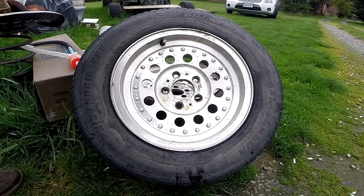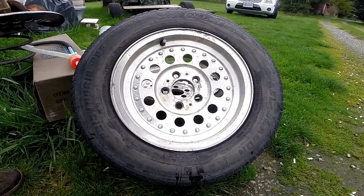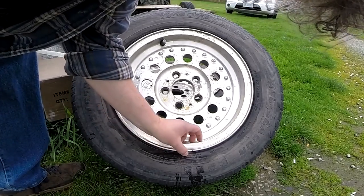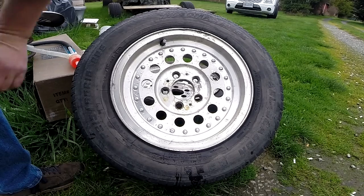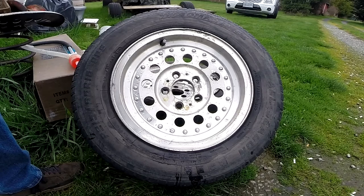You know, trailer tires maybe, but even those — standard load, meaning it's not for any high pressure application, it's not for a truck. The maximum load on this is 686, which is the lowest tire I've reviewed yet. The max pressure is 35, which is more what I expect out of a modern-ish tire. A lot of those other ones said 30, but I often run 32 or even 35 if I want to get some better mileage.